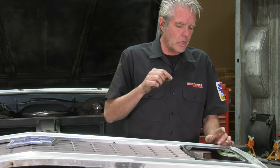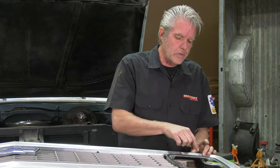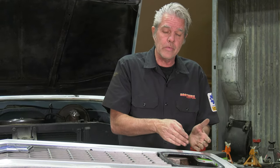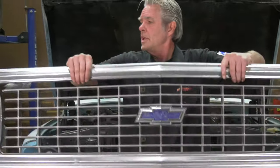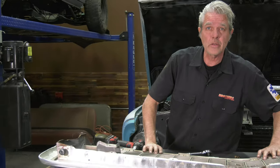If the drill bit is too small it'll simply go through the middle. If it's a little oversized, I might punch through all the way and drill the hole larger, and now the rivet won't work. So take a little time and make sure it's done right. Give me a few minutes to drill all of these out and then we'll get them cleaned up and start putting stuff back together.